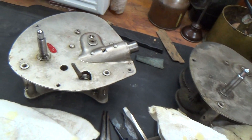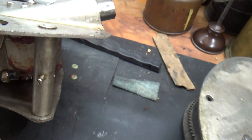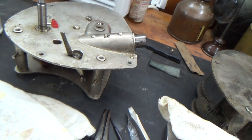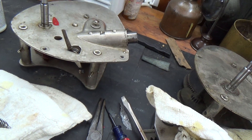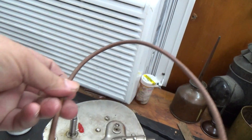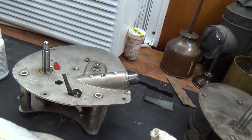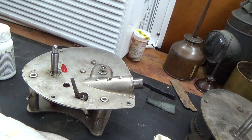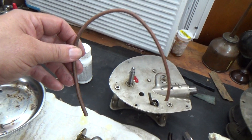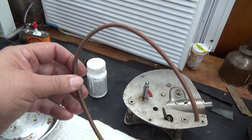Use a medium grade oil wherever there's a pivot. Make sure you lubricate this governor pivot — I've seen 102 and 101 motors where it was so neglected it was completely frozen, and that has to move so you can adjust your speed. This motor has a good friction leather. Some 102s will have a felt pad, which works, but you'll have trouble finding a replacement. The best material to use is a singer sewing machine leather belt from an early Singer — they sell these on eBay, they're about seven feet long: a lifetime supply.